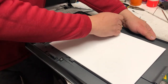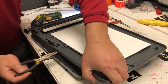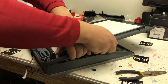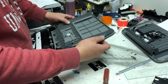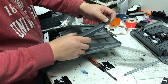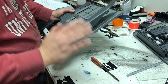Now flip over. There are two tabs on top and two tabs below it. You can have something put in place after you loosen the top tab. Then just push on the bottom tab and it's going to open. Now just wiggle the base and the whole thing is going to come apart. The left side of plastic just falls off. To remove the right side, you're going to push this tab in, and then you can sort of wrap your hand around it and just move this way.